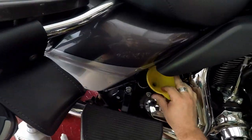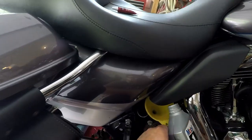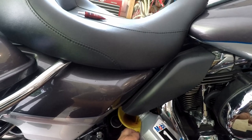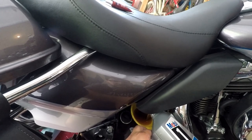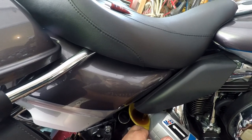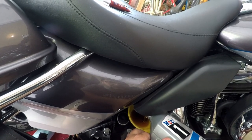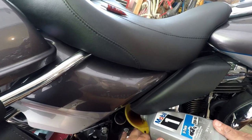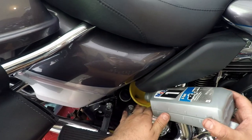We'll use the funnel and go ahead — just like the primary — put one quart in the transmission. I believe the specs call for 36 or 38 ounces and there are 32 in a quart, but one quart in each should do it. Always check your dipstick with a heated engine, so maybe after this we'll go for a ride for about 20–30 minutes and come back to check. For the primary, you can look in the cover and if the fluid's coming up close to the lip in an upright position, you're full.